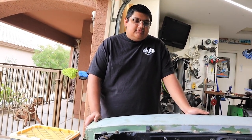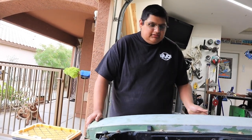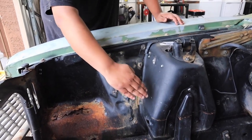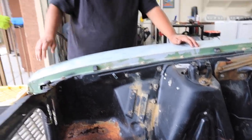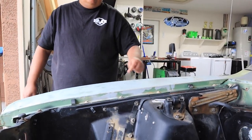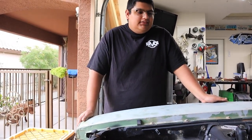No, those are for coilovers, that's why. Oh, really? Yeah, that's that RRS one. Basically, what they do is they cut it so that it actually dips in, like a half moon into the shock tower, because you relocate the shock over here. Oh. And also because I'm cheap. Yeah, that too. No, that's right.